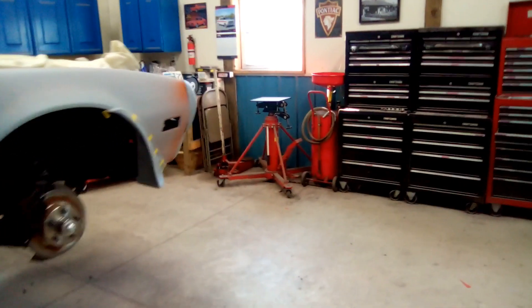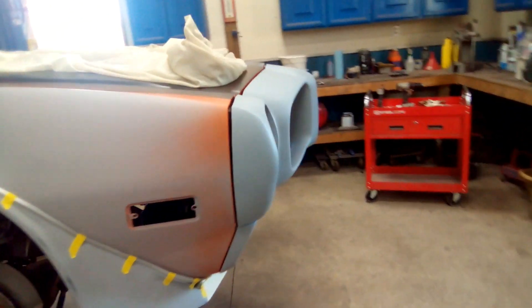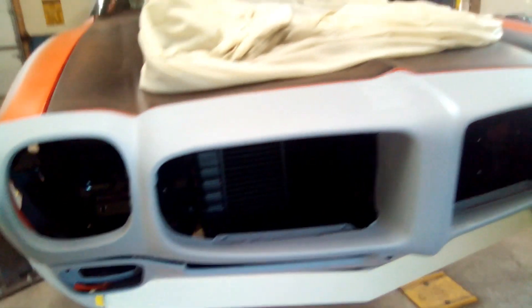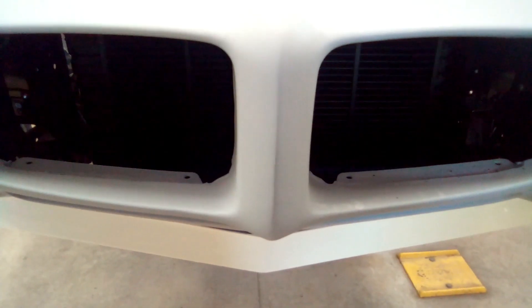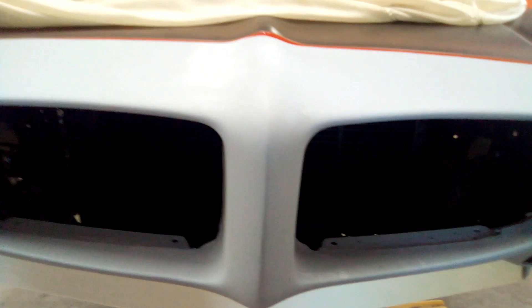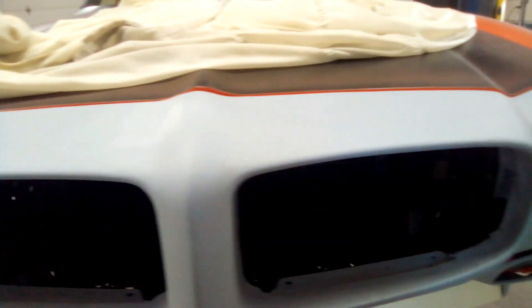The nose — I thought I did okay, but I think I messed up. I'm going to be sanding this back down. These noses are just terrible. I've got some cracks in it just from the primer — you can see a crack right in the very nose. That's really crazy to me; I think this primer is shrinking. I'm going to knock this primer back down — it's just more time spent but I know it'll be worth it in the end. I'm still waiting for the flex additive to come for this nose; I had barely a cap full left from a previous project, and that's what I used on my flares.